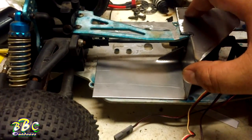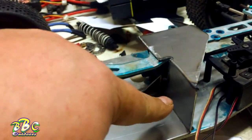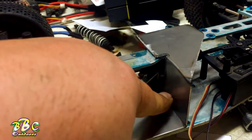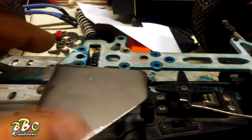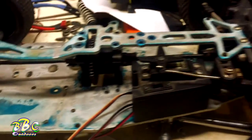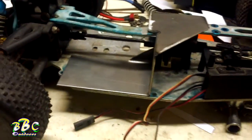We skip ahead and this is what we built — it's not been welded up or cut or drilled or anything yet, but this basically sits right there. Then we'll drill a hole right here for the motor to go through, a small screw hole, and we'll elongate a hole down here with the plasma cutter, bolt it all together, drill out these holes. I'm going to mark these holes from underneath — voila, one electric buggy.